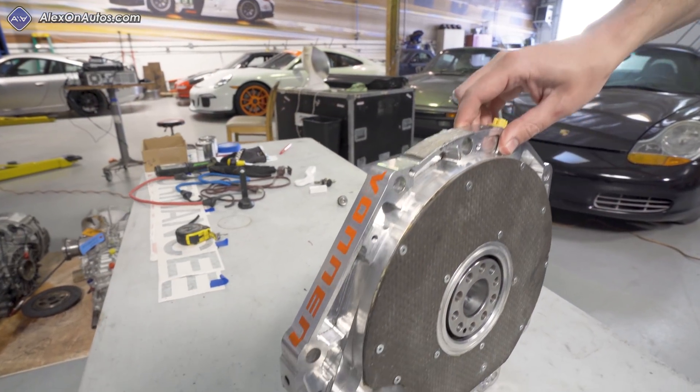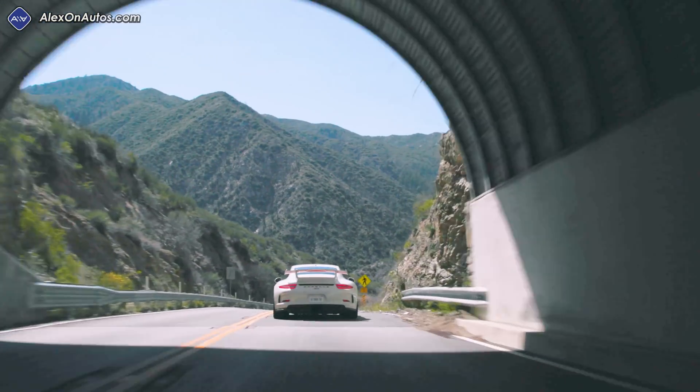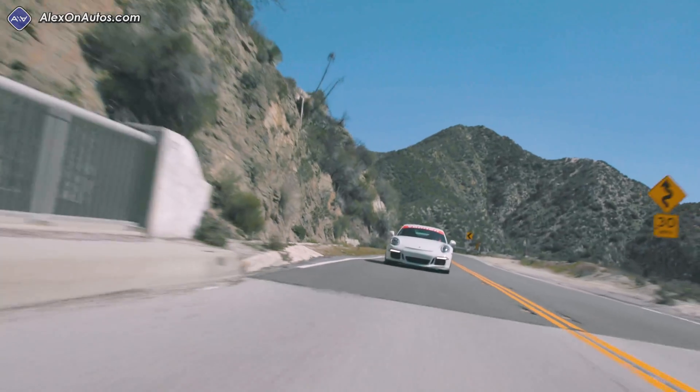So what are the disadvantages for this particular motor style? With this very compact packaging, there may not be quite as much room for cooling. Is it more expensive than a different format? It is more expensive, and it has to be custom made for each application because you have a motor and transmission interface that is unique to that vehicle or family of vehicles. Cooling is tightly squeezed inside — we offer max performance for a finite duration before the motor reaches its temperature maximum, and then it will quickly recover with the built-in liquid cooling.